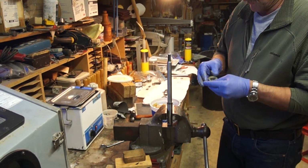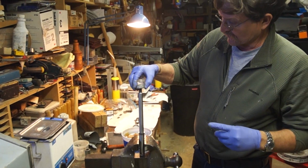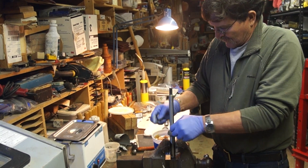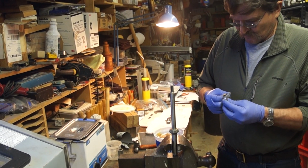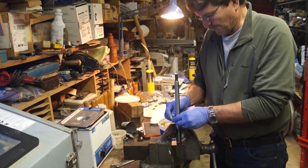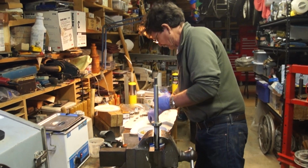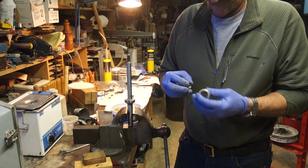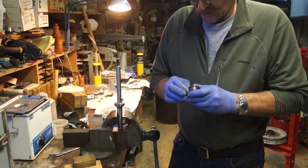This is the outer bearing, first bearing. The taper is like this. Slide that down. Here's the race. A little grease around the outer race. That goes on top. I just put a light smear of grease around the wedding band just for corrosion. Okay, put that in.